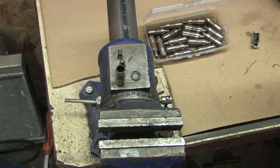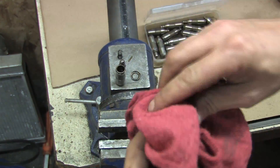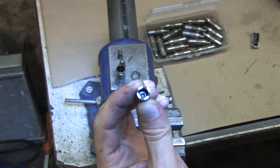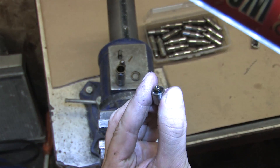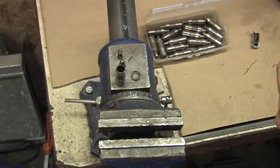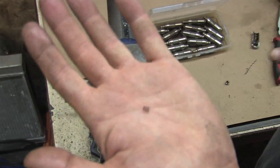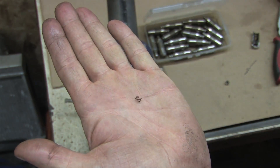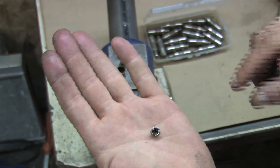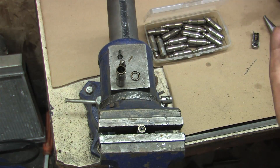So this is why it's important to meticulously follow your maintenance schedule. Clean all of your parts with carb cleaner and wear safety glasses — it's going to splash everywhere. Use clean, lint-free rags and wipe all the sludge from each part. The lower piston contains the check valve — it's a simple mechanism. It's pressed onto the lower piston inside that stamped metal cap, and you'll find a ball and spring valve inside it. You don't need to remove that part to clean it; there's enough clearance on that stamped metal housing to flush it out really well. But I took it apart just to show you.